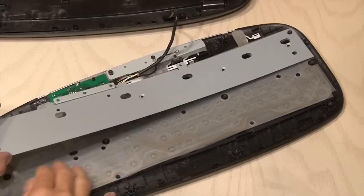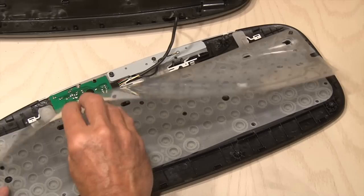This one also had a little metal shield that had a few screws that had to come out so I could get to the keys. You'll find a flexible plastic piece, which is the circuit board for the keyboard. We'll pull that aside, then we'll peel back the little rubber button sheet that comes in contact with the keys, exposing just the numeric keypad.